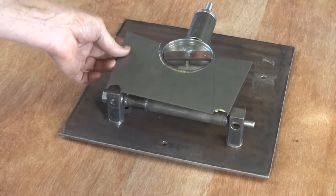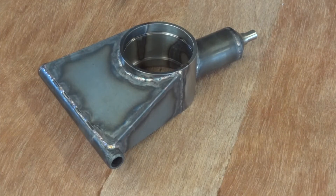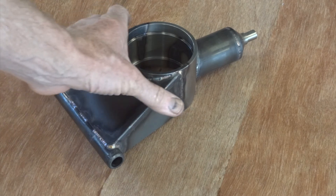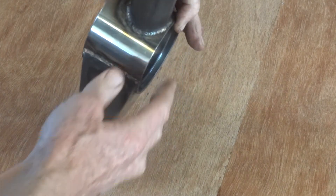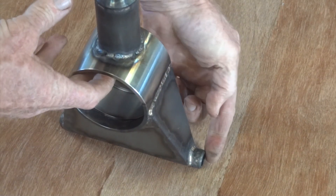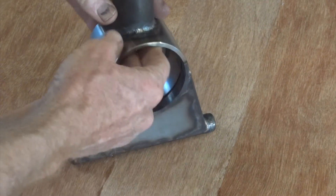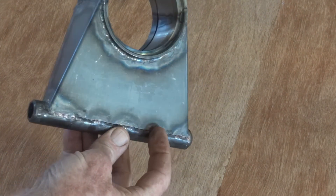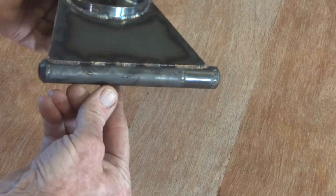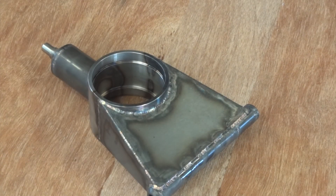From that we cut out a bit of 1.2mm chromoly 4130 sheet, fold it up, and start welding. And there's the finished article, all welded up. Little box down the bottom — that's the right-hand upright. So the wishbone with the spring and damper goes on there, toe control there, bearing in the middle, top wishbone here. And for my standards that's actually got some quite nice welding on it — good enough for a backyard job anyway.